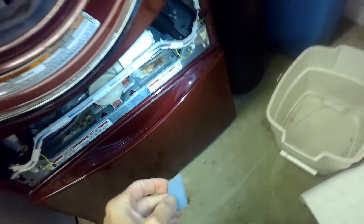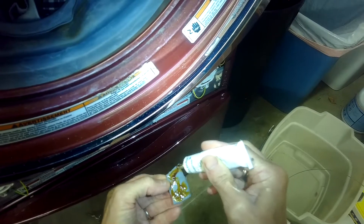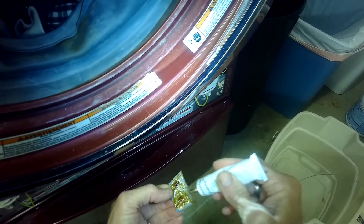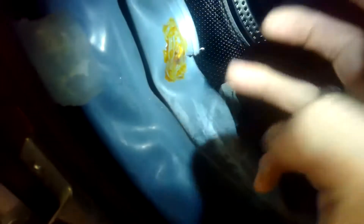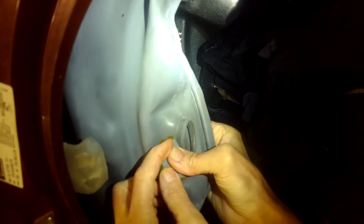Let it get tacky, seal that one up, spread it around. I'm going to go beyond where the patch is going to go just to have a little extra. I'm going to put some on the patch as well. We'll let that dry for about five to eight minutes so it's kind of tacky when you touch it, then I'll glue it on. It's one of the best ways to bind when you go rubber to rubber like that. It's tacky now — that's good. So we have our patch piece. I'm going to hold that on for a little bit, get it nice and tight, and then we'll reassemble. Goal is just to cover up that spot the best we can. Push in that patch piece and hold it down tight.